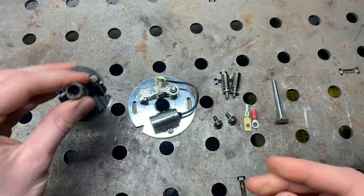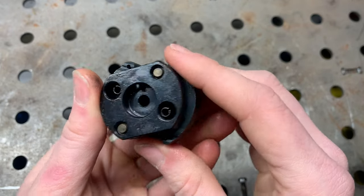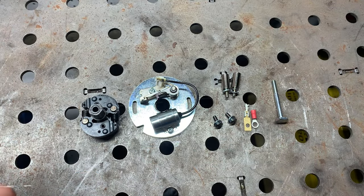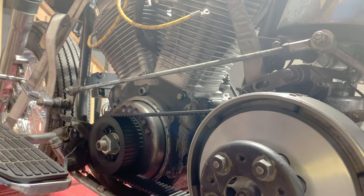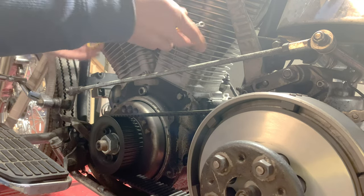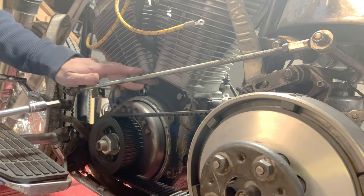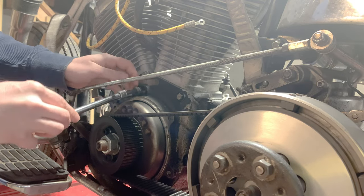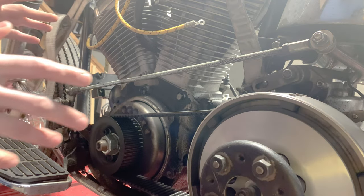Those are the components that come in the kit — very simple, not much to it. There's also another pin on the back here that nests into a slot on your actual nose cone; we'll show you that during the install. For the install, you'll need a way to move the motor — to actually move the pistons up and down. First thing: take your spark plugs out to reduce compression and make it easier to move the motor. Next, your timing plug is right here — use a 3/8 Allen to remove it.